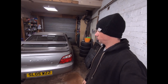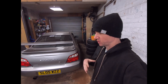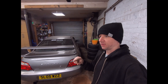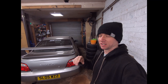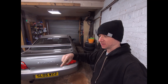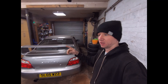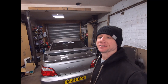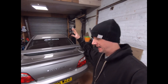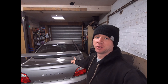I'm waiting for all the parts to come together, because if anyone's ever taken the rear end off a Subaru they'll know there's a long bolt that goes across the rear axle between the hub and the track control arms — and that bolt never comes out easily. I've ordered everything to replace all that: all the bushes, the bolt itself. I've actually got a couple of bolts here already, so when it goes wrong we'll have everything to replace it, plus the full exhaust system is changing out as well.